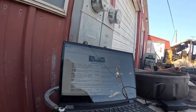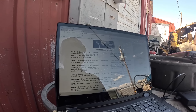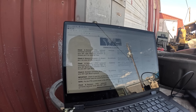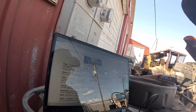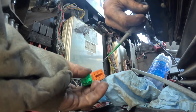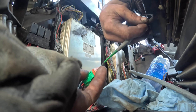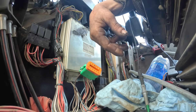There's the 597 wire right there — that one is green as can be. So between PTO solenoid connector terminal A for wire 597 and connector J2 green pin 4 — the wire that's supposed to be light blue is actually discolored and looks green, but it IS the blue wire. 0.5 ohms — nothing wrong with that.